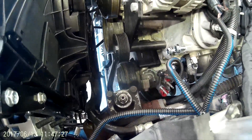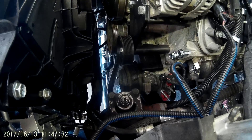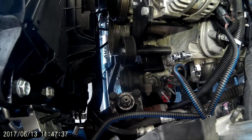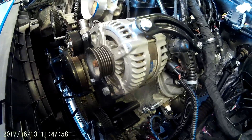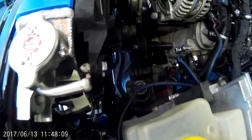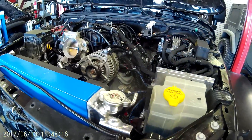That's the starter motor on the block. Over here you can see we have our billet AC bracket — it's bolt-on. We've made some improvements: you no longer have to tap the compressor; we have a nut plate that goes on the back, so it's all bolt-in, plug and play. Put your JK alternator right back where it was — the original connector plugs in, the original AC compressor plug goes right back in.